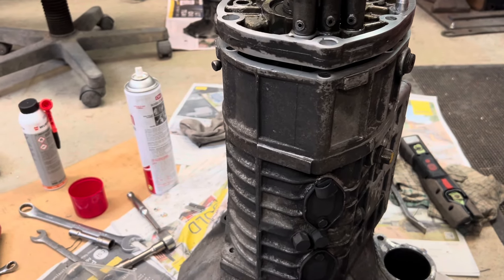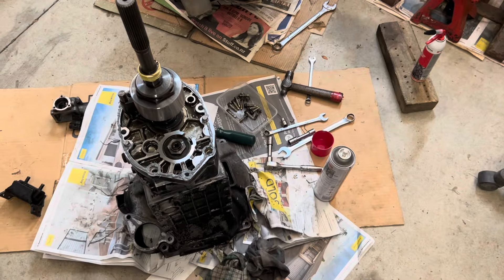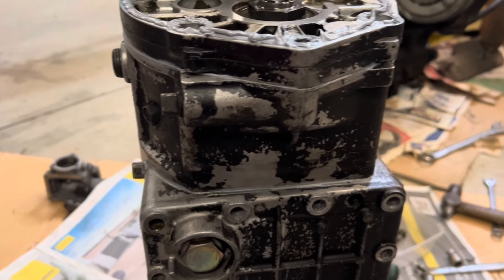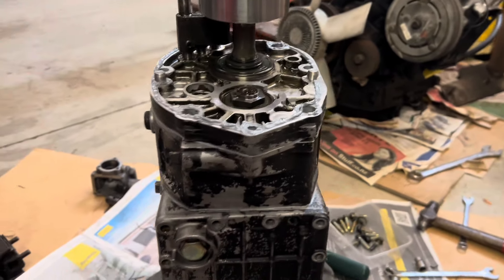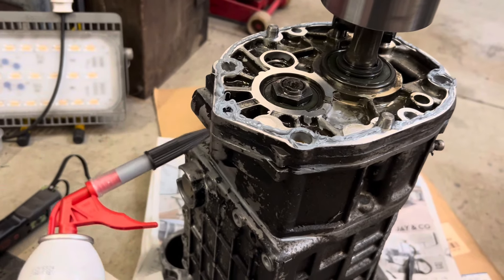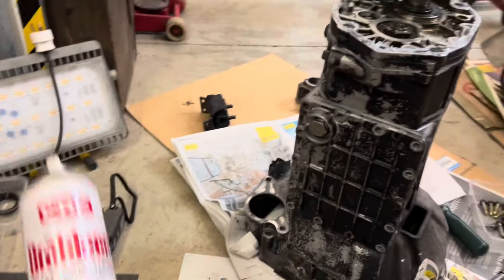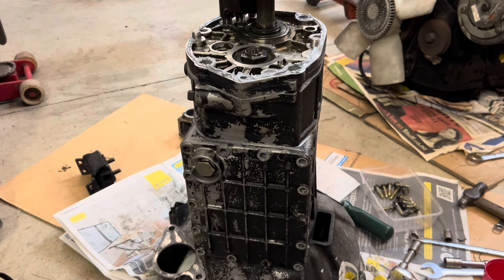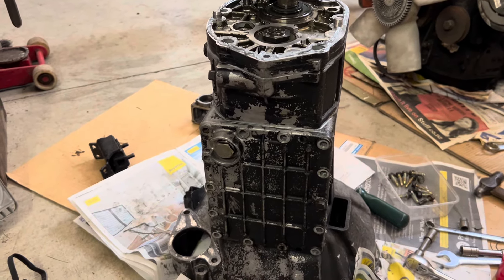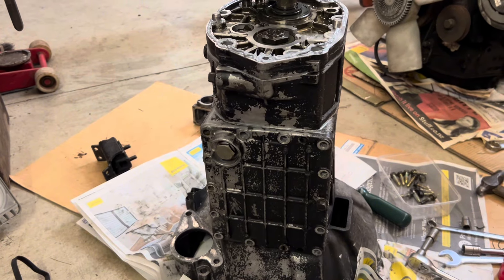So I've got in between the surfaces cleaned with my brake clean, my rag and my knife. Chuck some sealer in there and throw that part back together. I've put silicone around that already, done the two sandwich ones. The cool thing with using RTV with a nozzle like this is it just kind of gets in there easily. I use brake clean because it evaporates when I'm cleaning stuff - just get in there with a blade, get the worst of it out, brake clean the rest. As long as it's oil free the brake clean will prep the surface for the silicone.